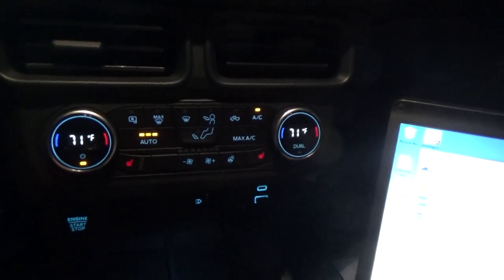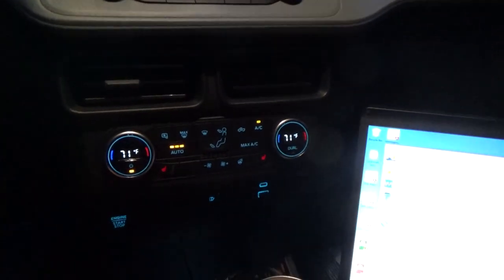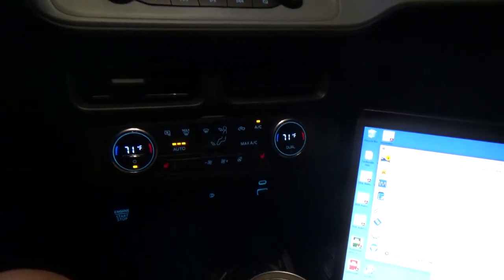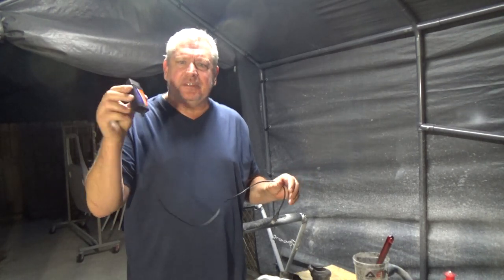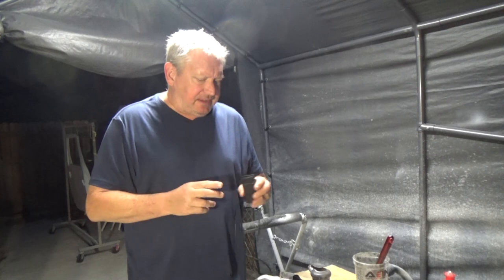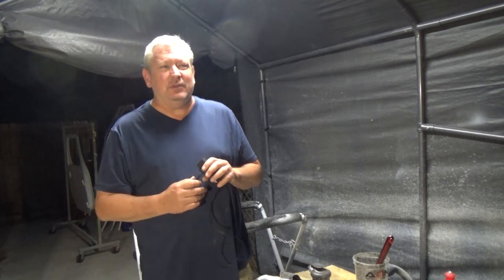I got that fixed, it's working. Was it worth $350? I don't know — you tell me. But when I look down here and see those little numbers, it makes me oh so very happy. This is the ELM327 adapter that you use for FORScan. Without that, the module wasn't working. I changed all the values to match my old Maverick from April, a couple months ago, that had that module in it — and it worked great. So if you want your numbers back on your knobs, spend about $350 and use FORScan to go in and change the settings. It works perfect.